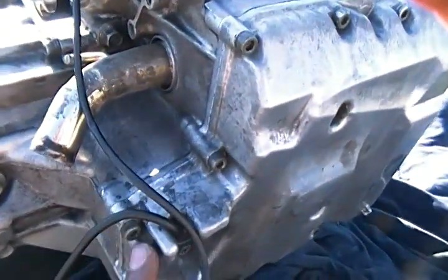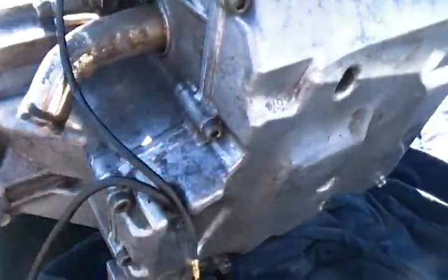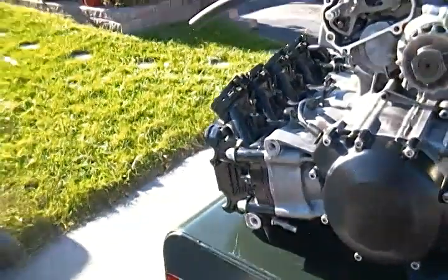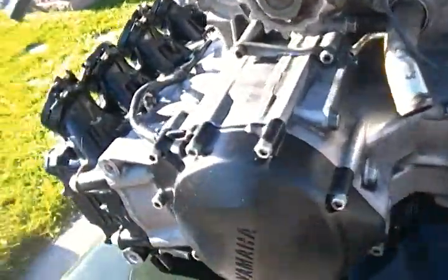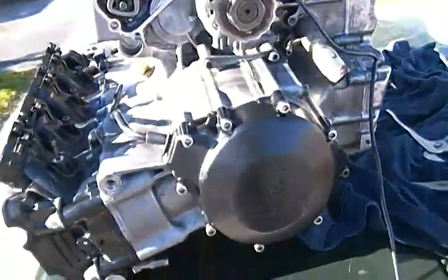But also remember to try and put the bolts into a separate bag or a separate basket. When it comes back to putting back the motor, that's where you're gonna have the most confusion. I can tell you about a dozen of these bolts I put back, and they're not directly supposed to go in there. Although it fits in there, it's not directly supposed to go in there.